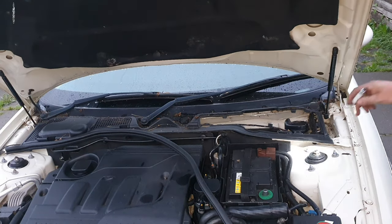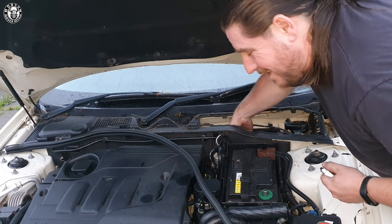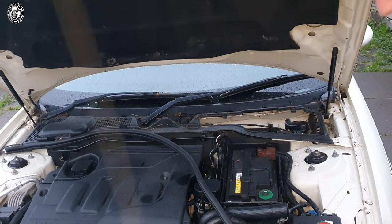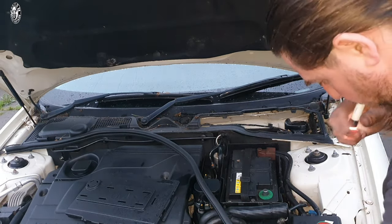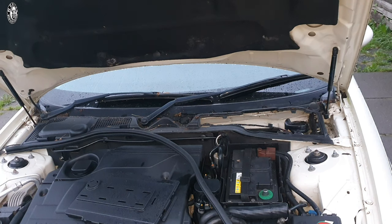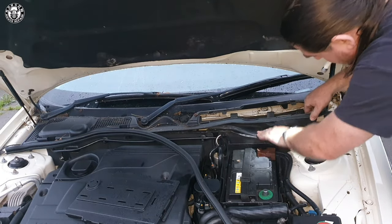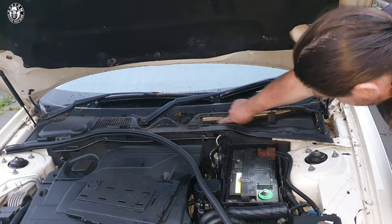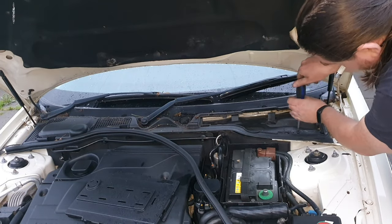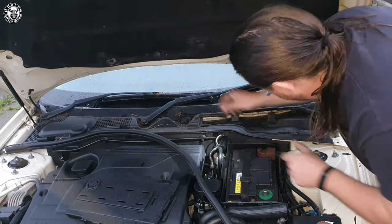Good — that's all in. Triple-check all four clips are on right; you obviously can't reach the front two, so it's important to do the back two first, then the front two. Now reassembling. I always check that it's the right scrivet before I go get the waterproofing panel. The waterproofing panel sits very nicely and snugly along the firewall — it clips in perfectly. Make sure it's sitting sealed right because you're trying to prevent water egress into the area. Push the scrivet back in and tighten it up.